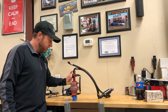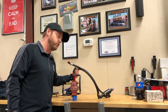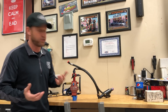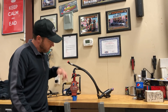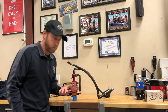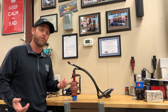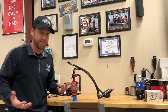After you have your pump loop, on a pump sized correctly to the engine you'll typically run between a 60 and 120 jet, depending on how big the fuel pump is, the atmospheric conditions at the racetrack that day, and how big you need the pump to be. On top of that you have the outlet, with a port where we measure port pressure. This goes to the race pack and we monitor fuel pressure in real time. We also monitor fuel pressure downstream, which is your first line of defense against failure.